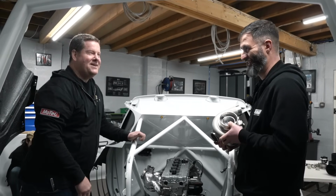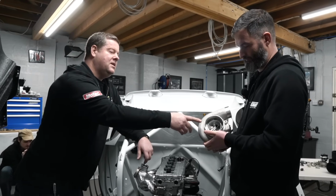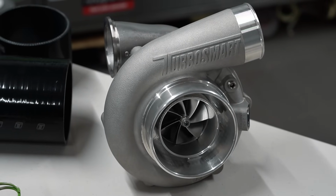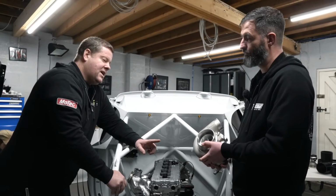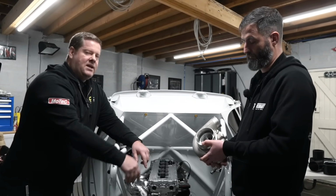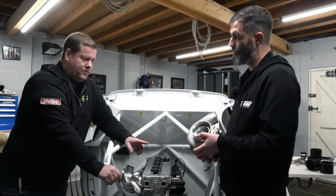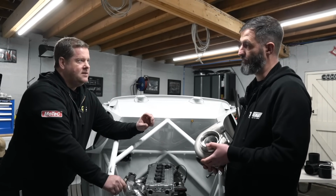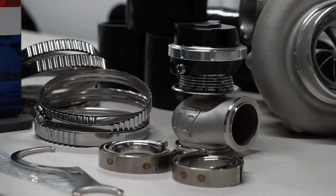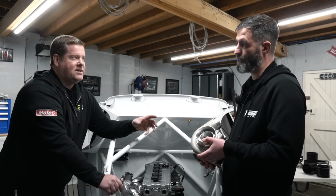Awesome. Open the window up of the rear Group S video here. So we're just discussing, we've got a turbo speed sensor provision, which we're going to add to the vehicle, and that should help us, because one of the key things is if you're going to drive a car at altitude, as in high up, that turbo speed is going to be very, very different from when you're at sea level. One of the things we can also work out, which we haven't got on those wastegates and blow-off valves, is a position sensor. We do, yes. For the wastegate. And for the blow-off valve as well. So they can all be data log channels, and then we could work out how much the wastegate's working.